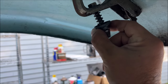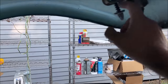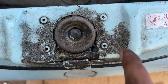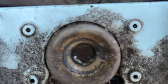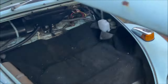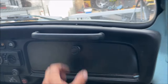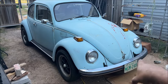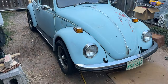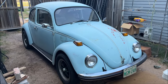We had no tension on the spring at first — stretching it half an inch made it a lot better. We are going to be looking for a higher-tension, thicker spring. We also took a little bit of slack out of that cable, but I think the spring was the problem the whole time. Put that latch all the way up — done. I did spend about an hour on the hood latch, totally worth it. If you enjoyed this video, please like and subscribe — thanks for watching.